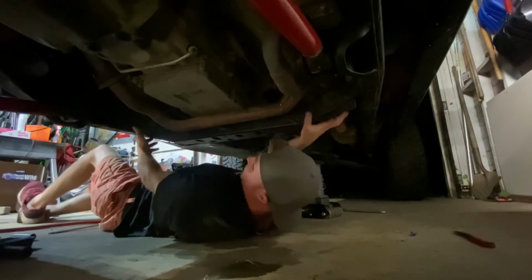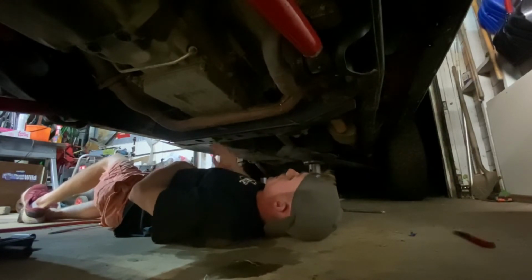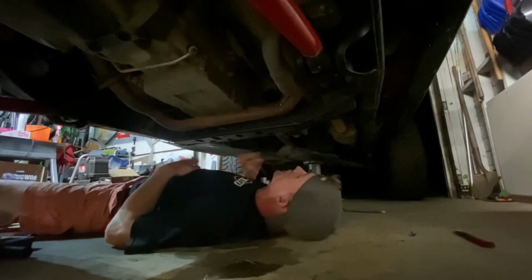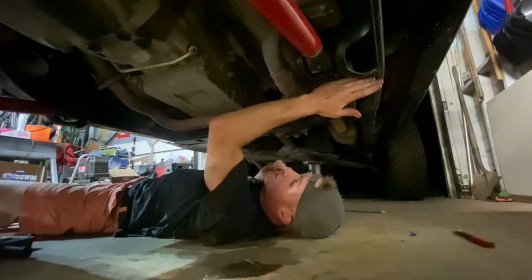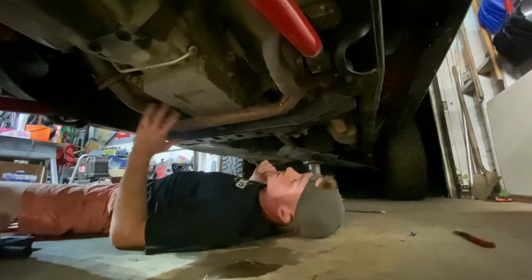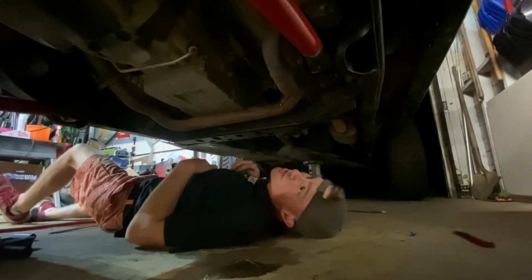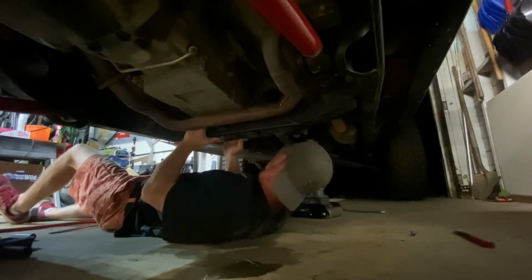All right, guys, so after I tightened down each of the side bolts, I went ahead and continued to tighten down the transmission mount onto the transmission crossmember using the three factory bolts or nuts. So now we're all snugged back up and in. I don't think this transmission crossmember is going to go anywhere. So if you'd like, hang on, and I'm going to continue putting the transfer case skid plate back on and the exhaust protection bar, let's call it that. They call it a skid plate, Mopar does, but I'm gonna call it a protection bar because there is no real skid plate underneath. Actually, my exhaust is looking pretty decent right now. I'm surprised. But yeah, I think this is definitely a lot more solid than what was in there, and hopefully it's gonna give me a little bit more protection off-road.